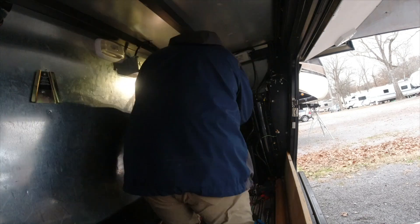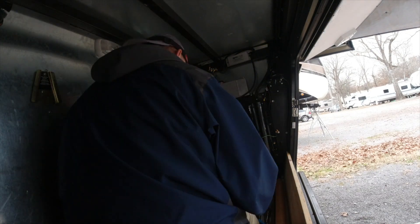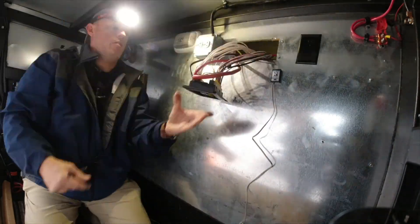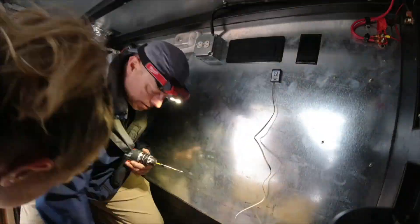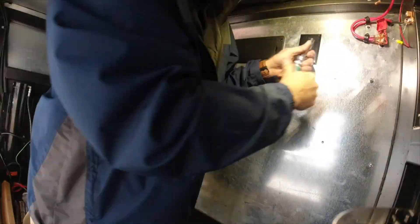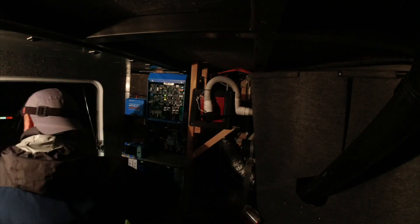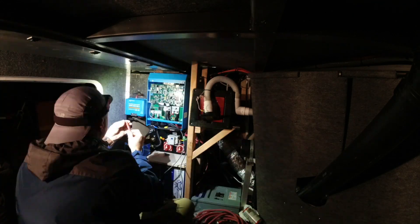The Lifestyle does it a little bit differently. Inside the coach, the breaker panel was only just a breaker panel - the actual DC connections are all here in the front bay. I had to rewire everything because now the batteries are no longer up in the front. They are all underneath the Multi-Plus, so I had to switch the way everything connects.